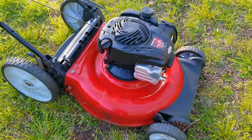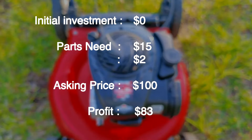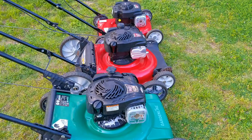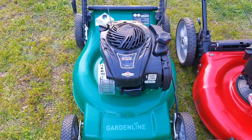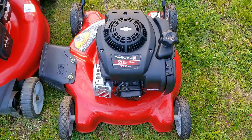This project was not a simple jet cleaning — there was a lot more going on that unfortunately took trial and error to figure out. But after all the changes were made it didn't leak anymore and I was confident about selling it. This mower didn't cost anything, however I did have to replace the carb at a cost of $15, and I also had to replace the air filter at a cost of roughly $2. I'm not going to include the fuel filter because it was something I already had from a different kit, but it'd only be a dollar anyway. Here's the deal: if I had decided the day that I fixed it to sell it, someone would have bought it not knowing there was a very slow fuel leak getting into the oil. As time went on more and more fuel would have mixed with the oil making it less of a lubricant and more of a fuel, and potentially would cause the engine to lock up in a year or two. Which is why sometimes holding back on a sale can be very beneficial — not only to the buyer but to your reputation as well. I think I made the right choice. I'm not saying that I'm a saint, but I do at least want to try my best to sell something that I wouldn't mind keeping and using myself.